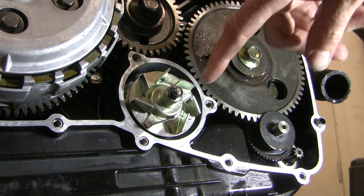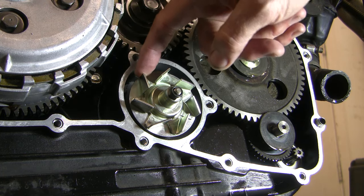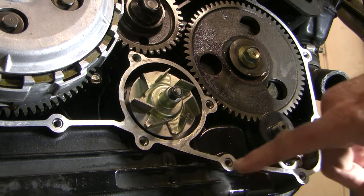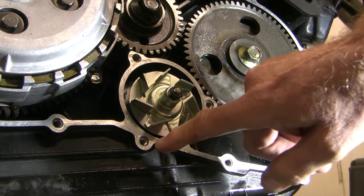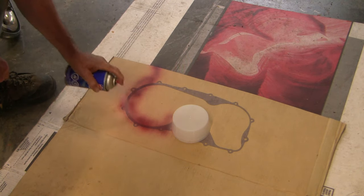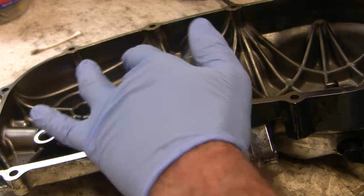I'm a little nervous about this next part because in this spot we've got pressurized coolant and a thin rim that has to be 100% intact. Pressurized coolant could leak through this area into the oil and I wouldn't notice until the next oil change. Normally I use a dry gasket for water pumps, but in this case I'm going to use some RTV type sealant to seal just this area because I'm very anxious it not leak here. This is high tack — just to stick it to the case. That shouldn't be enough to cause any harm.